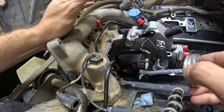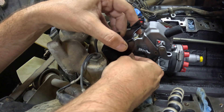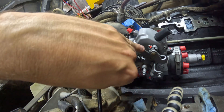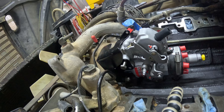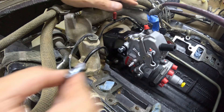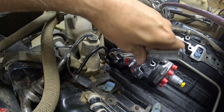The pump retaining bolt on the left side is a little bit of a special case because the bracket that holds the throttle cable is over here too. I'm going to put a bolt in kind of loose in the injection pump and bracket to get it lined up, then put the nut on. There's actually no torque value in the army maintenance manual, and I'm guessing part of that is because it's pretty difficult to get a torque wrench in here. Then go the throttle cable bracket bolts — there are two of those. No sense stripping out the threads of the injection pump.